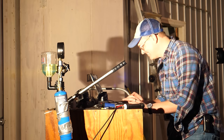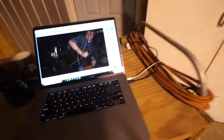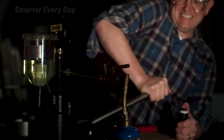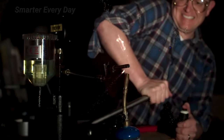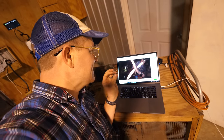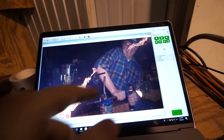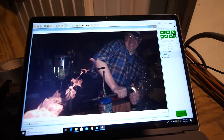Okay, here's what I learned here. When I first started squirting it, it was just liquid, just like a solid stream, but it wasn't until the correct vaporization, or the cloudiness, if you will, started that it actually lit fire. So that's key to combustion. You've got to have the right surface area of the fuel to the air, and of course you've got to have spark. So, okay, we didn't light one of the streams, but let's try it again. Let's see if we can get all four to light.